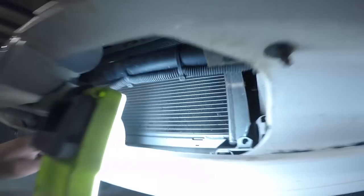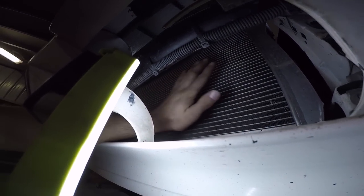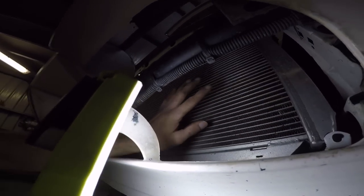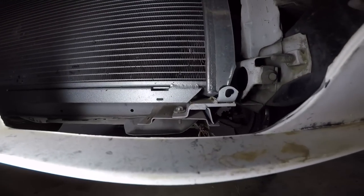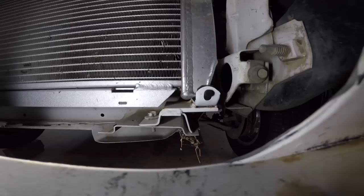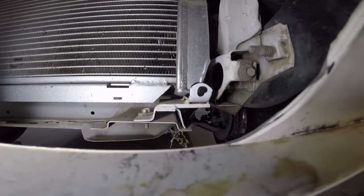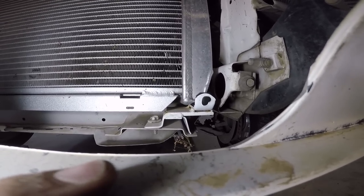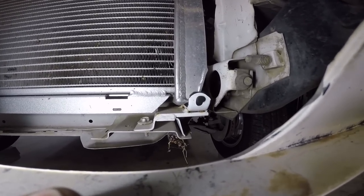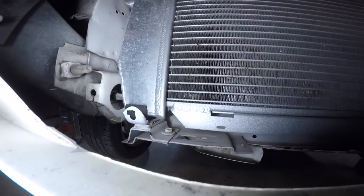So obviously that front, I think what they call it, condenser or something, for all the AC stuff, I've pulled out. And just the radiator there, and that is the standard XF radiator mounts with a bit of 5mm flat bar welded onto it, and then the standard top half of the mount, which I drilled the spot welds out and then just shifted them over about 30 odd mil. Then I just got the rubbers and cut them up with a Stanley knife to get them to fit the bigger radiator.